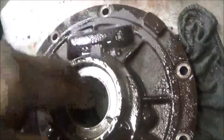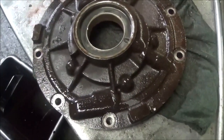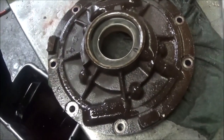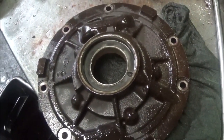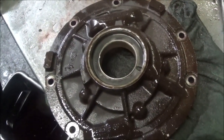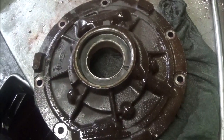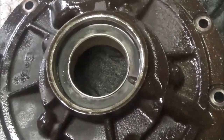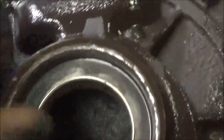Alright, so let's show you this. Front pump leaking out of the front pump area. Many people, when they have a leak coming out of the front pump area, the first thing they assume is that the seal is the problem. I very rarely have a problem with a seal going bad — very rarely. What I have seen is almost always something with the bushing or the torque converter. Also, it's very rare to see a cracked pump if it's an aluminum pump. I have seen one in about 15 years where the aluminum pump was cracked, and we took it out three times until we realized there was a hairline crack in it. But for this 4L-80, I don't see where you'd get a crack in this big cast iron pump. But again, the problem on this, as you saw, was the bushing.